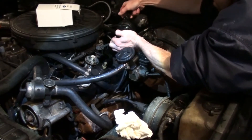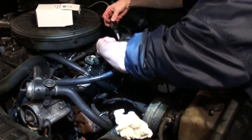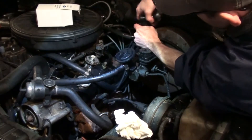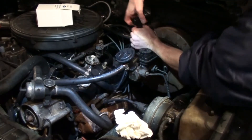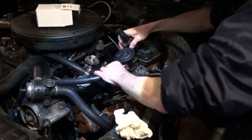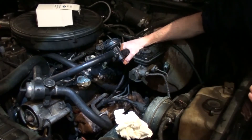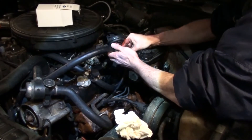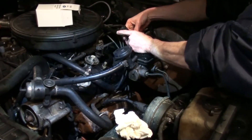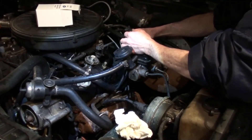I can take the other outlet hose off. There we go — there's the old heater control valve, the one that's been leaking. Now I can put the new one back on. Hopefully you can see that well enough for it to help you. Once you get involved in this job, it is pretty simple. I'm going to switch the direction of that band to where it's easier next time. I try to make it so the bands are facing me — that way when you unscrew them, it's just a lot easier.